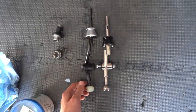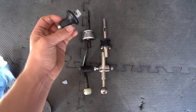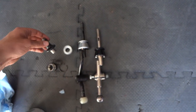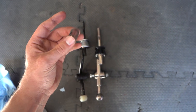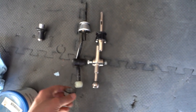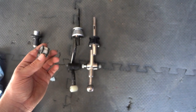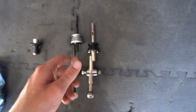Everything lines up, looking pretty good. These are all the pieces — this is what that little pin was holding. The pin slides through there. This spring is obviously what you feel when you go up and down, and this is the little cage that was holding the ball. So we got some fresh grease as well — I'm going to lube the ball, clean everything up, and put everything fresh. I'm going to switch these guys out and we're ready to go.